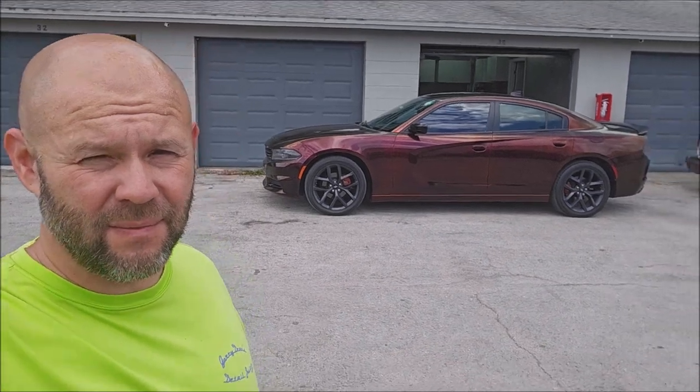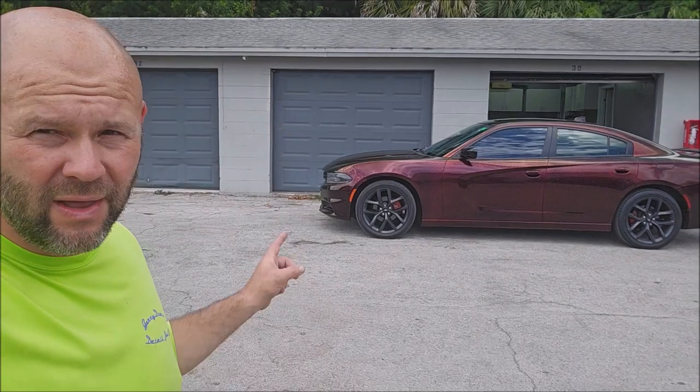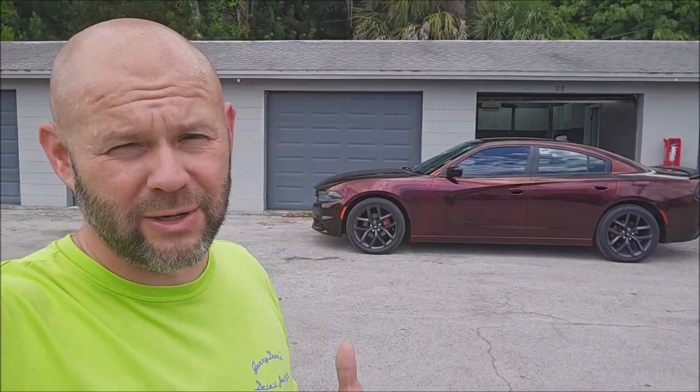So that is Versacoat 13 with some super shift metallic flakes. It's a little different than the pearls. The pearls are a smaller granule. These metallics, it's about a 0.015. If you know your sizes for metallics, it's a pretty large chunk. I had to shoot it on there with a 2.0 millimeter tip, which is pretty big. Really, next time I go at this, I'll do a 2.5 millimeter tip because these chunks are massive.